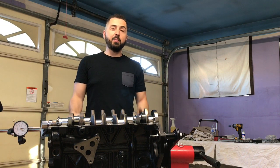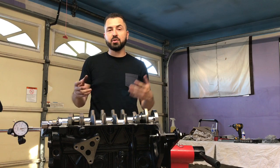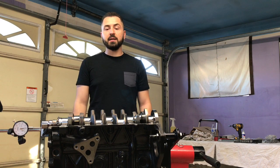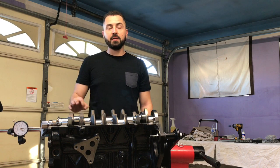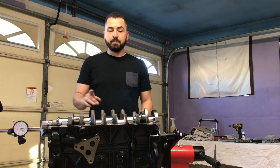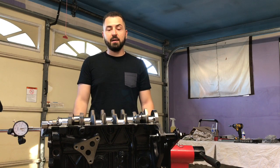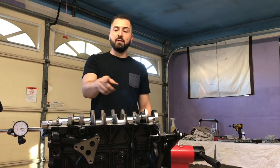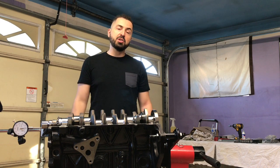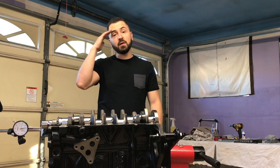It's been a long day. I hope you guys enjoyed this and maybe learned something. I'm sure I've made some mistakes with numbers and verbiage. But it looks like the crank is perfectly fine — oil clearances are good, axial play is fine, especially with the new bearings. I think we're good. I'll get one shot of the top of the crank at the mains. Next video we'll actually start putting the bottom end together. Less talking, more doing. See you on the next one.